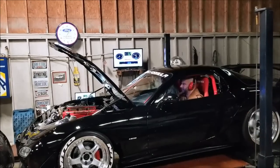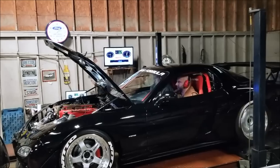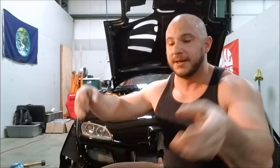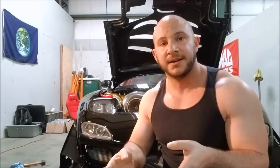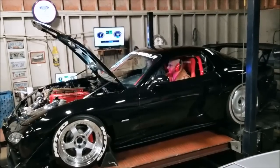So you want to make the intake air charge temperatures as cool as possible — that is what an intercooler does. An intercooler is essentially a radiator for the boosted air exiting your turbocharger, just like a radiator cools the coolant going through your motor to keep it from melting. The intercooler cools the air going into your motor to prevent detonation and give you maximum horsepower.